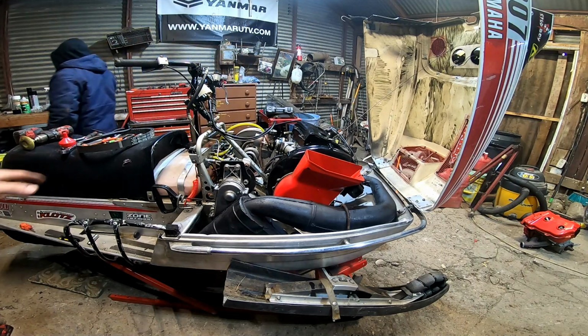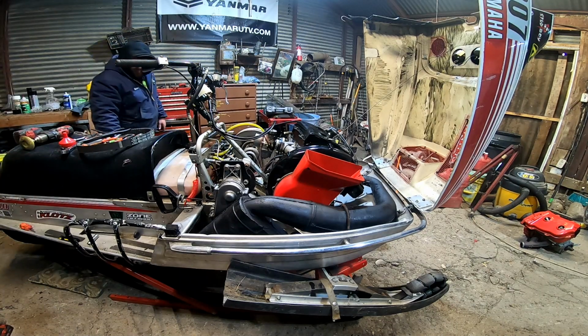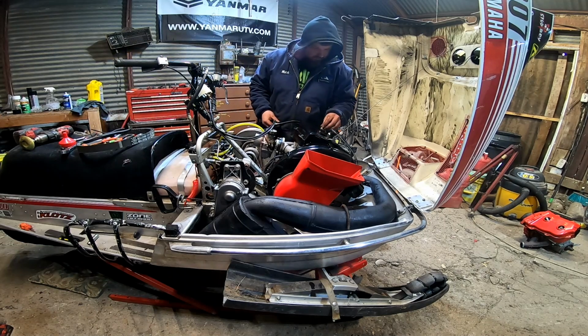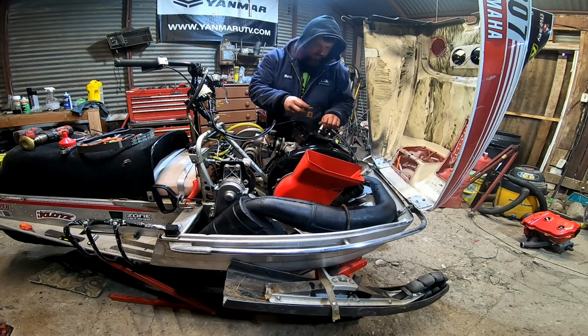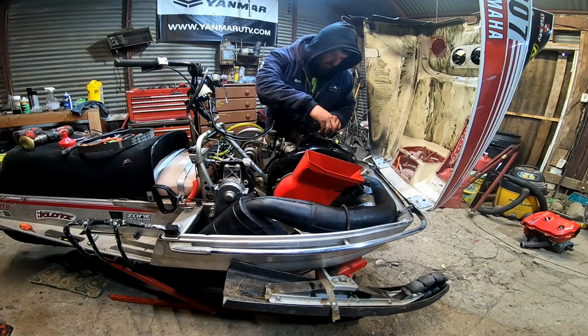We just gotta get new fuel in it yet, guys. Pre-mix it with 32-to-1 with Mercury racing oil. And then I'm gonna go get a primary clutch figured out, slap that on. At least you have something to run. We don't want to run an engine without a clutch on, of course. Belt we got there is probably fine. I have one in the house I might throw on quick too. And then we're almost ready for the first startup, I believe.